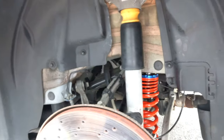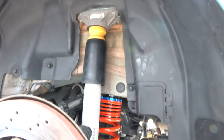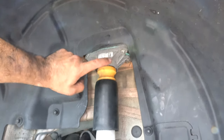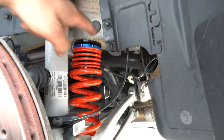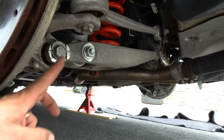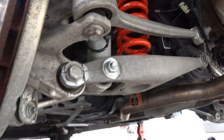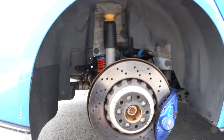Let's take a look — we are all done. Starting from the strut: we removed it, replaced the bump stop, installed the springs, adjusted the height to be uniform on both sides, torqued all the bolts to spec, and made sure the alignment lines match so the alignment is not completely out of whack. The other side is looking identical, so there's nothing else left to do than put the wheels back on and start working on the front.